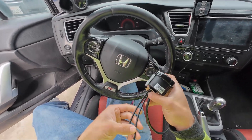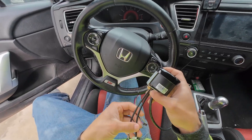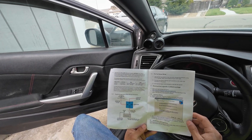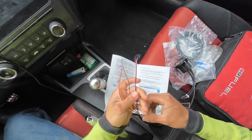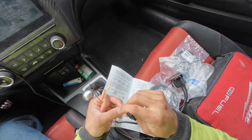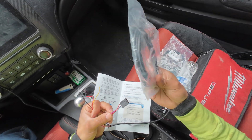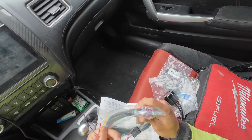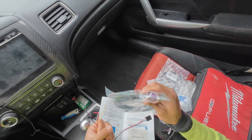I don't even know what all of these things are for, so here we have the four-pin programming cable. I'm literally figuring this out in real time. So I got the wiring diagram figured out — this connector right here plugs into this longer one. These plug in together, and then this big brown connector plugs into the fuel sensor itself. You do not need to use the white wire or the brown wire — white wire is for dimming, brown wire is for fuel temp.